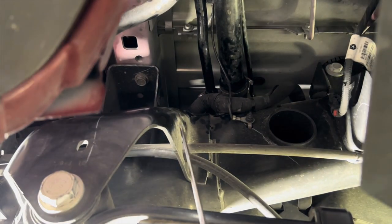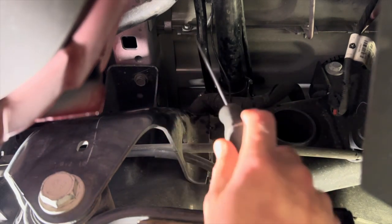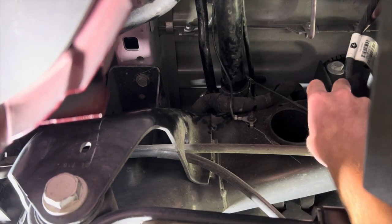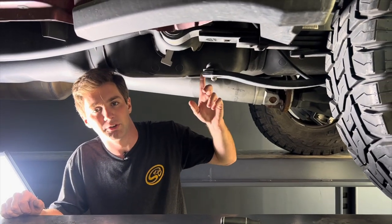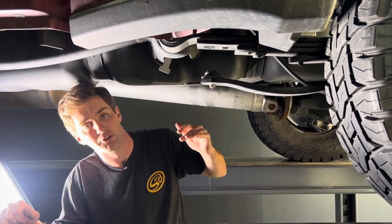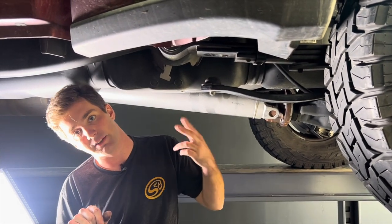The first step is we're going to go ahead and remove the hose clamps on the filler neck and the fill vent. To do so, we're going to either use a 5/16ths socket or a flathead screwdriver. You can see the head on the hose clamps right here. Just back that all the way off, and on the other side it will be loose as well. Once those are loose, you can slide the hose clamps up and off. These hoses can be a little bit of a pain to get off, so we're just going to wait until the tank's on the way down a little bit — that's going to give us some more room to pop the two filler neck and fill vent off the metal.